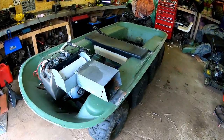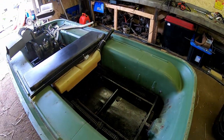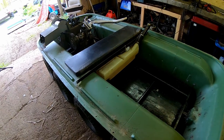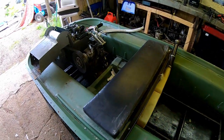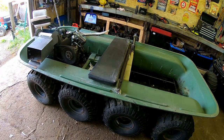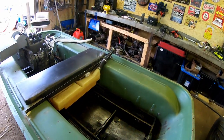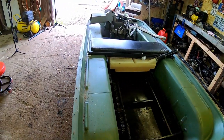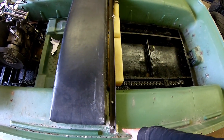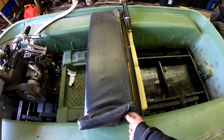We are back to a rolling bathtub. She's pretty dirty — I might wash her and even bed-line the pans down there. The tub's got nice rigidity for an old tub, actually pretty rigid still. One Argo I scrapped recently was really floppy, but this one holds up well. As for the seat, it's an old outdated design — literally just a piece of angle iron as the main support — and it doesn't flip up, so it's all going to be changed.